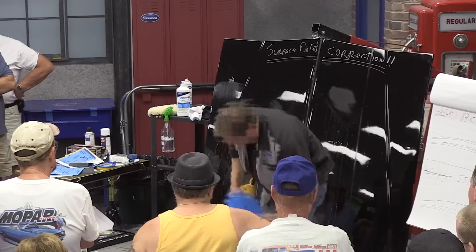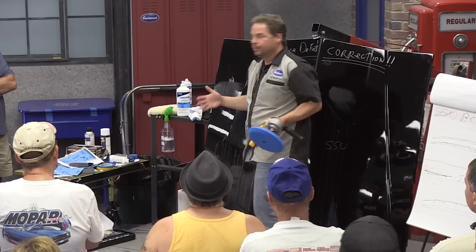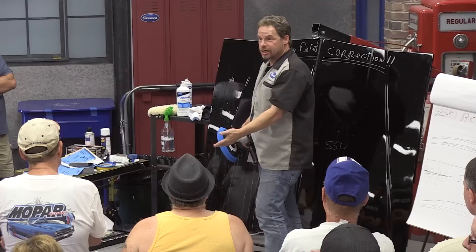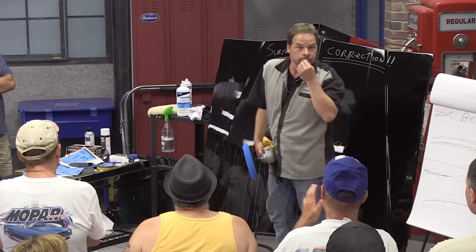The next step in the liquid system is the blue pad — locating nub here. How do you know you're done with the wool? If I'm looking at the panel from the side and I'm reading that surface and I can't see any more scratches, then I'm done with the wool. If it's ghosting, if it's hazy like in these edges, I'm not done — I'll do another application of compound. Juan Alejandra taught me that when it looks like you're done, give it one more pass. On your first initial compounding stage, give it one more application — it's just insurance.